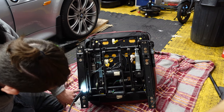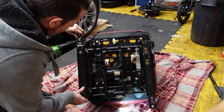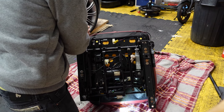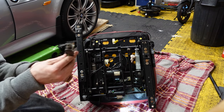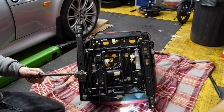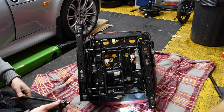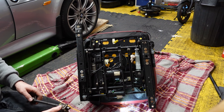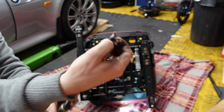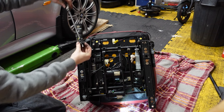There's a window — you can see how much is poking through from there. Then we're going to lift it, and this has come out just like that. You can see the bushings have completely disappeared. What we need to do is also remember how far in and out this is — we've probably got two threads. I can see two threads above the top line, so that's where we need to situate it when we put it back in the hole.